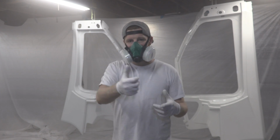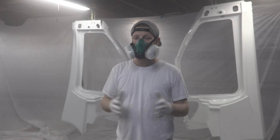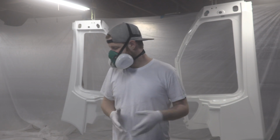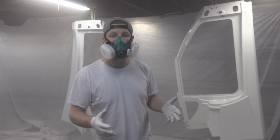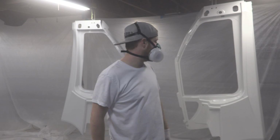And when I have full pressure from my air compressor at the first start, it worked fantastic. The problem is once my air compressor can't keep up with the gun anymore, it doesn't work as well as a detail gun, obviously, because it's trying to spray a proper amount of paint. So my paint job is going to take two or three times as long, but I'm fine with that because I'm painting these small parts one at a time anyways.